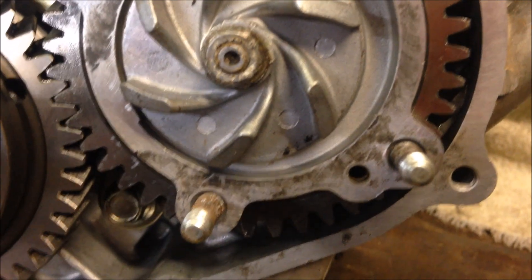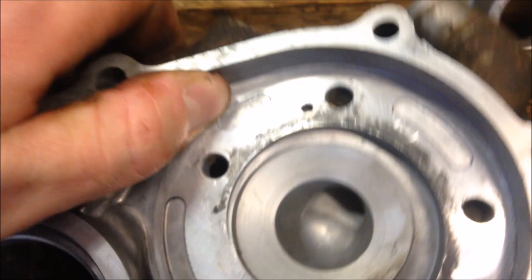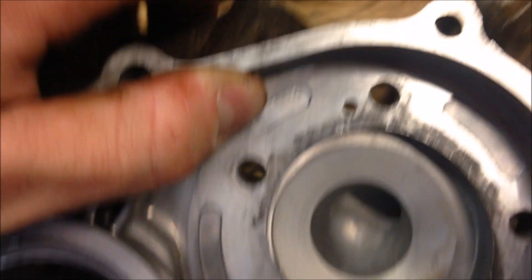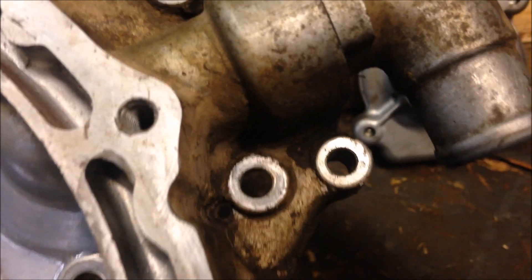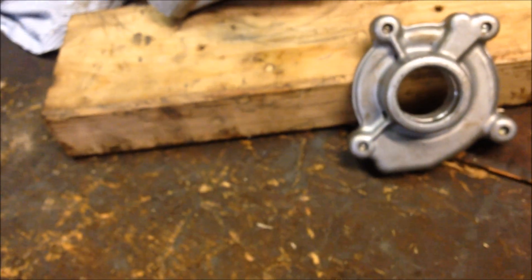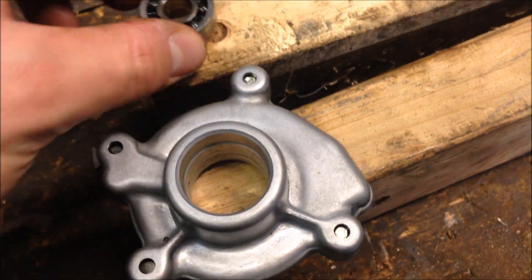The important thing to keep in mind is that hole there — it doesn't come out there, it comes out through that hole there. So how it would look installed on the bottom end is like that, and on the mating half there's actually a hole which is open to atmosphere. So if your water pump seal leaks, it'll actually leak out of there, through here, through this case, and outside onto the ground — that's a telltale sign you need to replace your water pump seals.